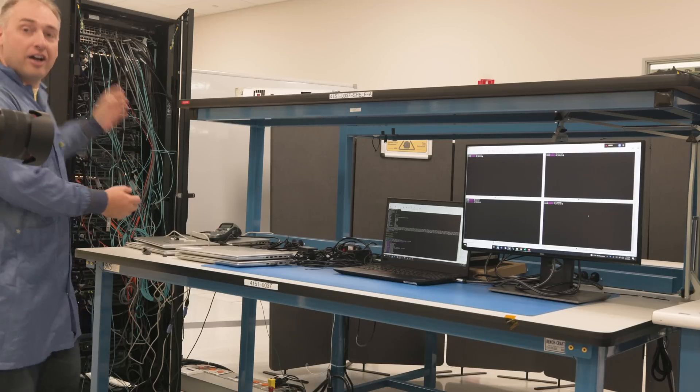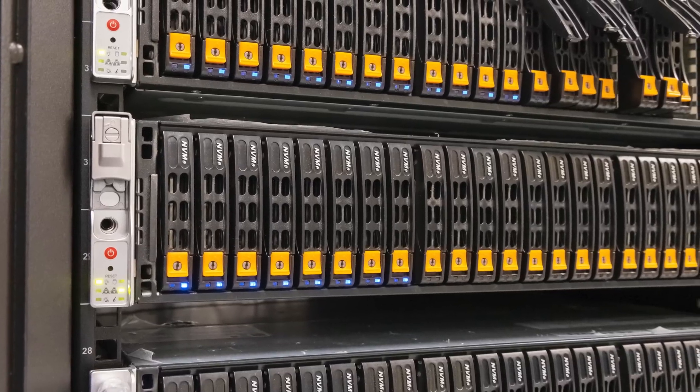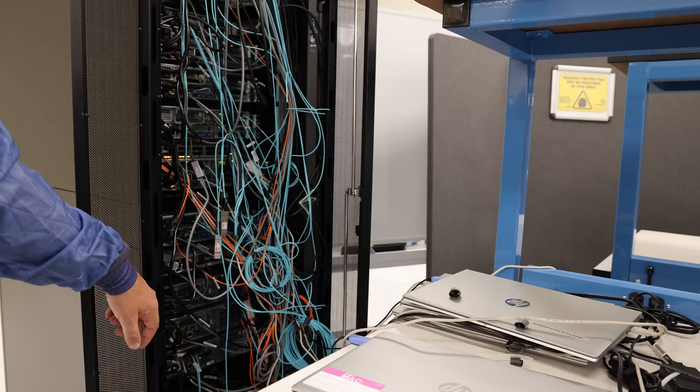We're actually going to set up this demo and explain how we use this card in the broader sense. We're able to do NVMe over fabric and create a diskless system. We basically have a rack full of SuperMicro servers, and where we were when doing this is the Santa Clara lab. We have a target system and a host system, kind of like you would do in any fabric-type storage, along with a whole bunch of NVMe SSDs — specifically the Intel P4610 NVMe SSDs — and Big Spring Canyon IPU cards in the back of the systems.